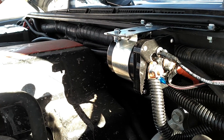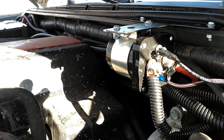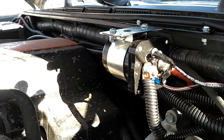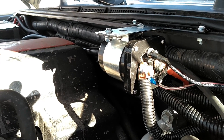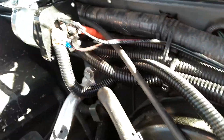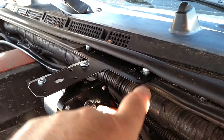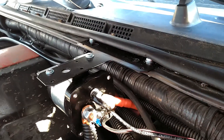What we've got here is 6-gauge wire, and this runs over to the battery, as I just showed you. I also have a ground wire connected on the battery side — the passenger side — at the same grounding point that the factory battery cable is connected to. Both of those come across here. Everything's loomed, so you won't be able to see much. This is coming down and going back around to the battery, and this is the load side coming out, which goes through this loom.